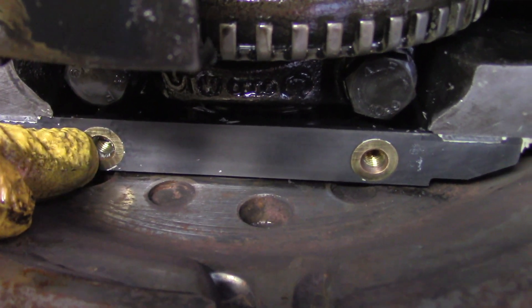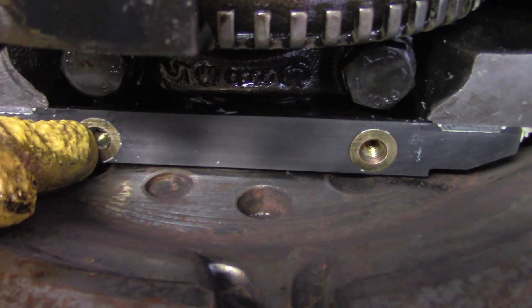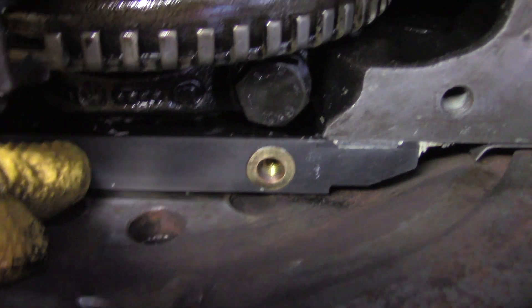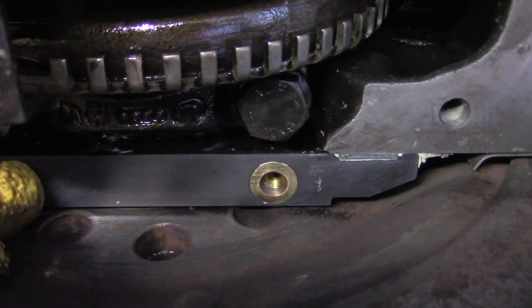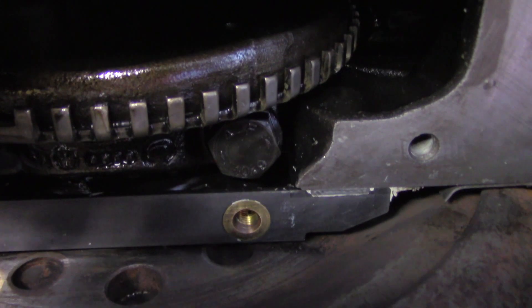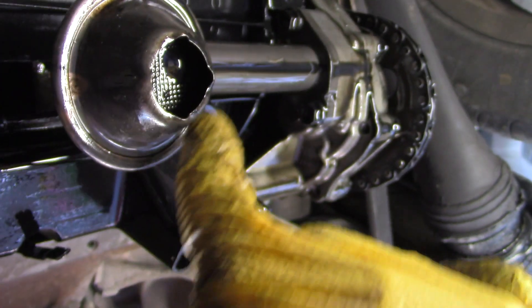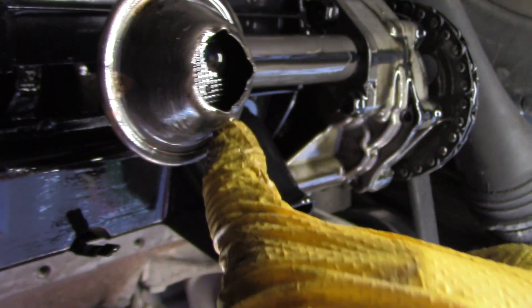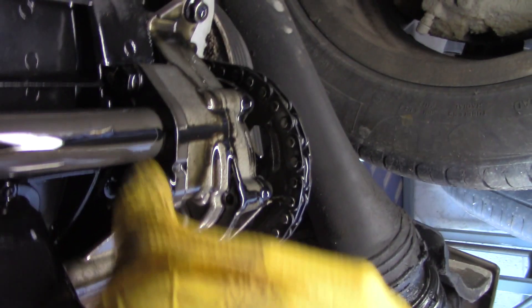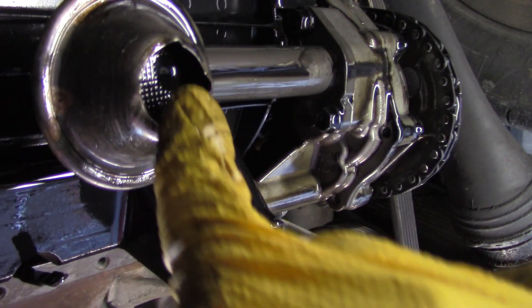This is plastic — I think these are studs embedded in the plastic, sometimes they're aluminium. Definitely don't over-tighten these, just sweeten them up, because that housing is actually the rear crankshaft oil seal housing. If you split that, you're going to have a drip underneath your car. Keep it all clean. Also just check your strainer for the oil pump — if it looks a bit grubby, take the two screws off, take it out and clean it.